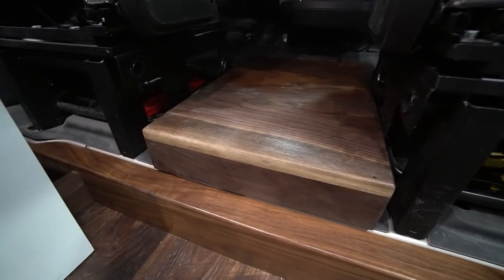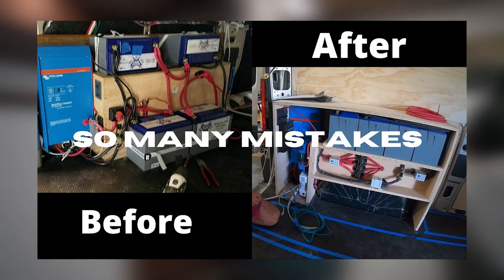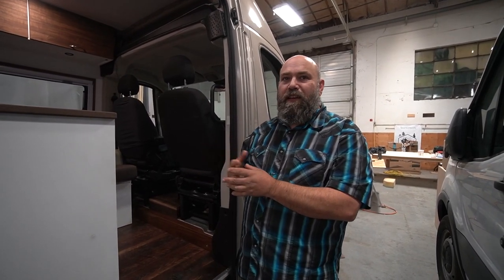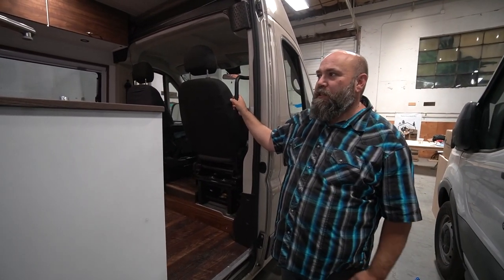There was a heated floor that didn't work, and a converter that went from 12 volt to 24 volt but was too small, so it was overheating. We basically went from taking out the galley and finding a bare wire, to taking out the sink and finding plumbing leaks, to digging into the power system and finding multiple fire hazards. Each layer we peeled off revealed more things that were really wrong. It was a lot of work to deconstruct and reconstruct.